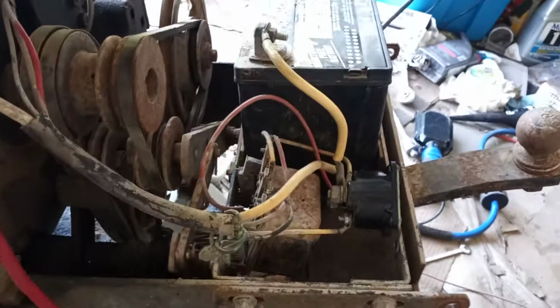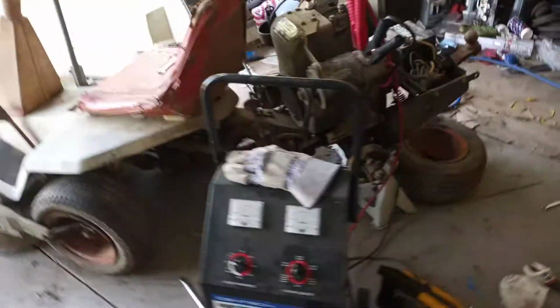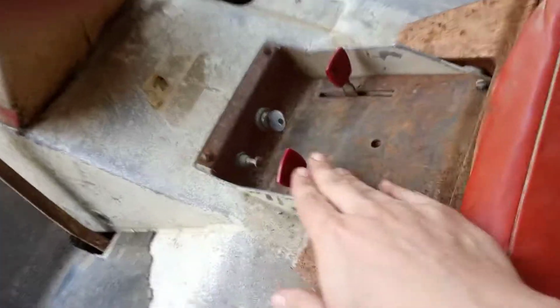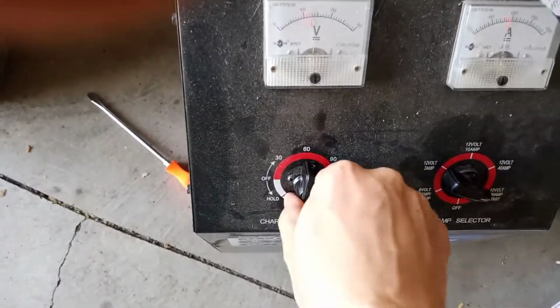Let's see. Now, I popped this solenoid because this one wasn't big enough, and I tried starting it earlier with fluid and left it running too long and popped that one, so I'm just jumping it right off the starter and it should fire up without any fluid. So turn the choke on, give it some throttle, set the battery charger.